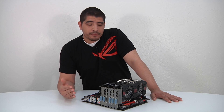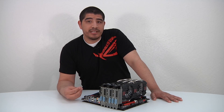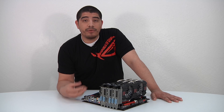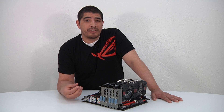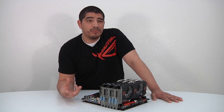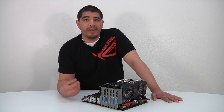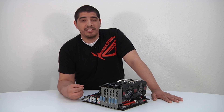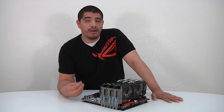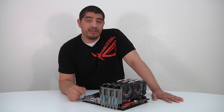Whether you're upgrading from a GTX 260-class product — which lacked DirectX 11, tessellation support, and many image quality technologies, and ran much hotter and less power efficiently — you're looking at 3X-plus performance increase. GTX 470 users are looking at about 1.5 to 2X increases. And for the 500 series, keep in mind this card is faster than a GTX 580 — so if you bought a 560 because you couldn't afford a 580, this card is consistently faster than a 580 by quite a bit. Overall, really impressive for the money, with great performance, power footprint, acoustics, and temperature performance.